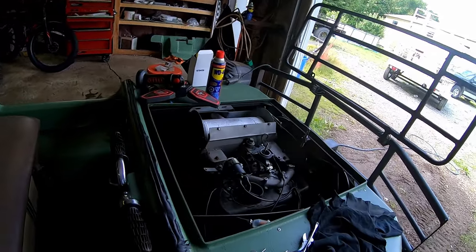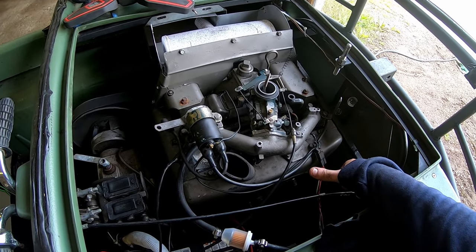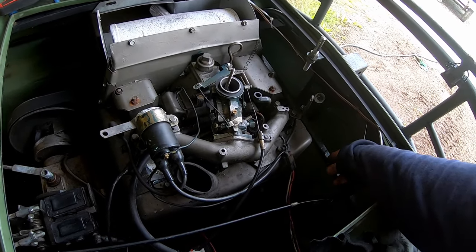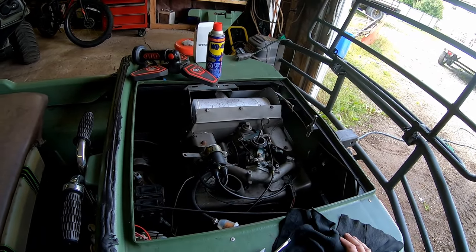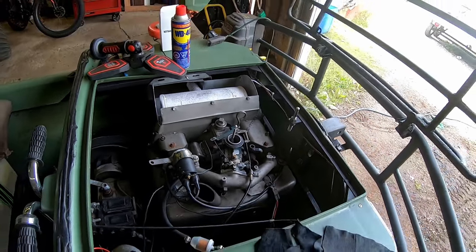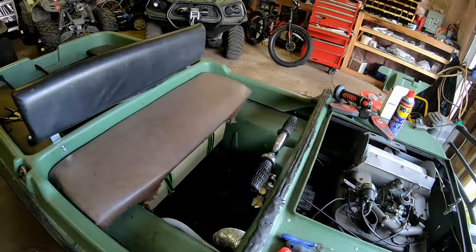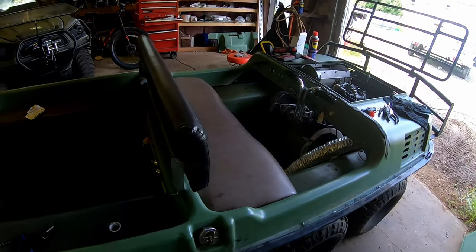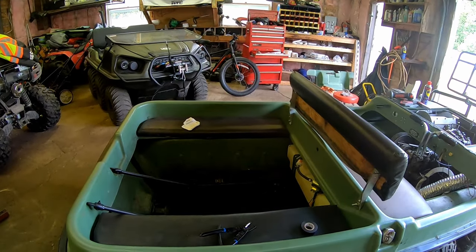Oh, also, I forgot to mention, I'm going to be running an electrical fuel pump for the time being. I have an alternator on order, so you guys will see a homemade alternator kit made by me. I might use the support brackets that I have, because you can see I've got the frame support brackets for the winch. Normally, the little voltage regulator that sits here might charge 2 amps. Not even that, a couple milliamps, I mean to say. It just acts like a trickle charger. I've got a 20-amp alternator that's going to be coming on this bad girl. So she'll keep that fuel pump going, and she'll keep my winch and my lights going. If I want to add a cab heater, she'll do that as well.